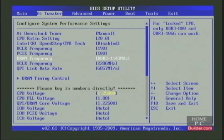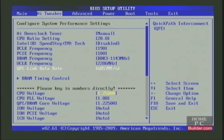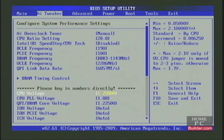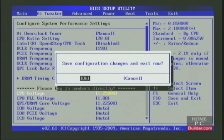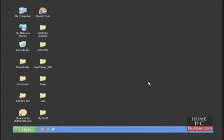The RAM, UnCore, and QPI changed automatically. The RAM changed to 1143 MHz, which is well below the RAM's rated speed of 1333 MHz. The UnCore is at 2286 MHz, which is twice the speed of the RAM, and the QPI is at its lowest possible setting. We want to see if these new frequency settings will work with the current voltage settings, so I won't make any changes to the voltages. I'll press F10 and enter to save and exit. We've just entered Windows, and there's an error in Windows Explorer — this is a possible sign of an unstable overclock.